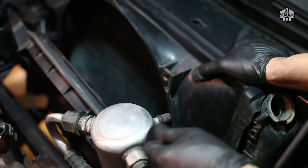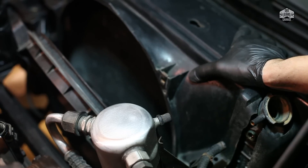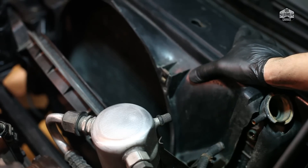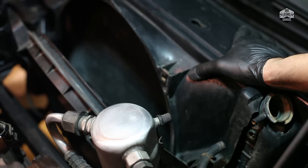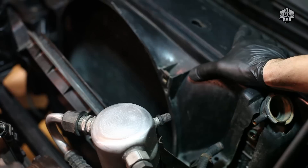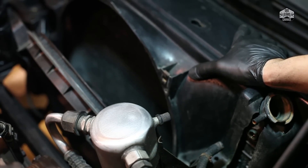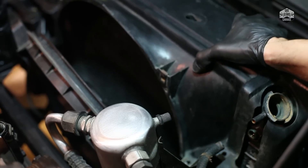Before you start this job, make sure you flush the radiator system completely. Reach down to the bottom right-hand corner, find the drain cock, unscrew it, and let the radiator fluid flow out. I left it sitting overnight to make sure it was fully purged. This is also a good time to do a full radiator flush, check your hoses, and — I also made another video on how to do a throttle body bypass — take full advantage when the system is already drained.